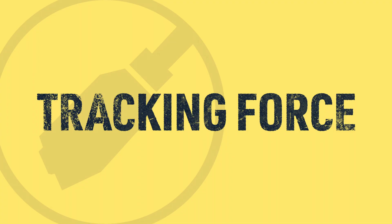The next thing relevant to that is tracking force. When you put the cartridge down, it's going to have a certain force on the record. That tracking force is measured in grams — if it's too heavy, it can damage the cartridge or the record, and if it's too light, it won't play properly and will most likely skip. The tracking force is usually a range set by the cartridge manufacturer. The Clios recommends 1.7 to 1.8 grams, while the Maestro Wood tracks a little heavier at a recommended 2.2 grams, plus or minus 0.3 grams.